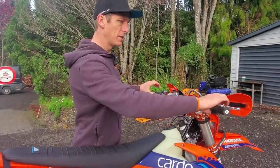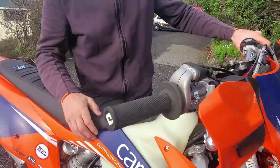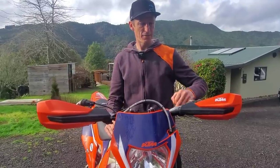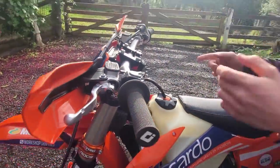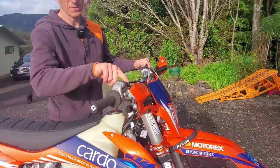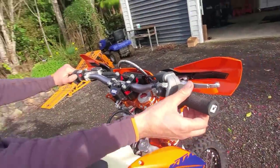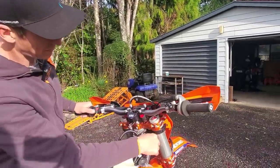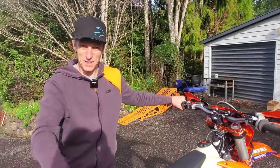I run my levers quite a long way inboard, so I'm right out on the end of the controls — that gives more leverage, more power into the front brake, more control, and easier feel on the clutch. I run a bit of tape underneath the clamps so the bars will move in a crash rather than snapping off. I'm also running a single throttle cable — I've got rid of the return cable — which gives a nice soft throttle action with less drag than a twin cable setup. I route it to the inside of the triple clamps to make it less likely to hook on bushes during hard enduro races.